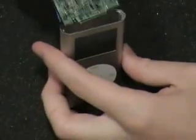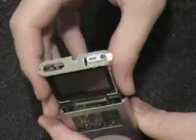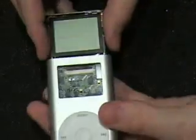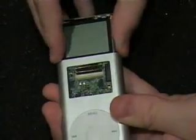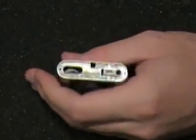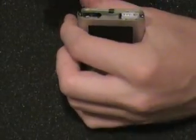Grab the casing — there are two small notches and you want to have the iPod going behind those notches. Simply push the iPod in; you might have to maneuver it around. Do not force it in, but just maneuver it without breaking the LCD screen. If the iPod or LCD screen turns on, do not worry — that's sometimes a side effect when it touches a contact.